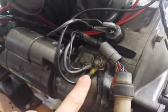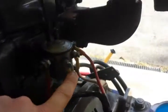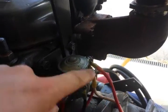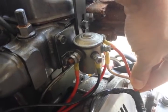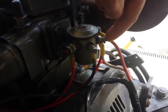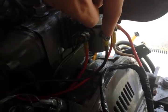In order to close that solenoid in, as I mentioned, I have a ground point here which runs up to this. I have a switch terminal here — this is going to be power, this is typically off — but you'll also see I have a power terminal coming here. So this runs off to your switch, in this case it runs off to the control panel. So I have power going to the switch, power coming back from the switch. And when power is made up to this terminal, it energizes the coil inside and goes to ground.